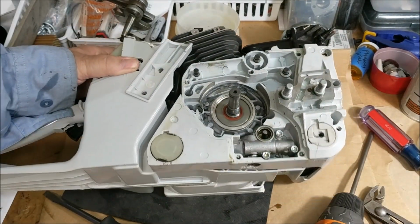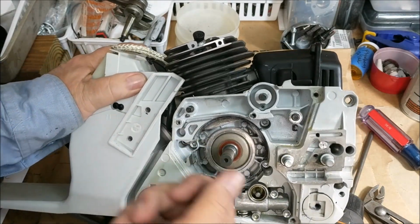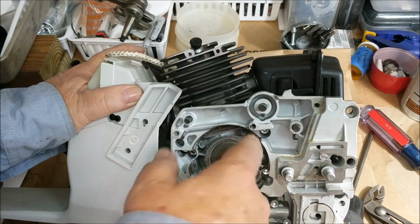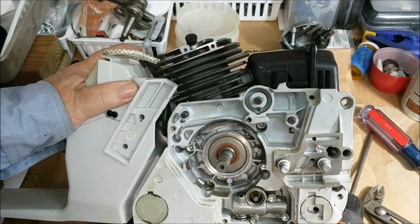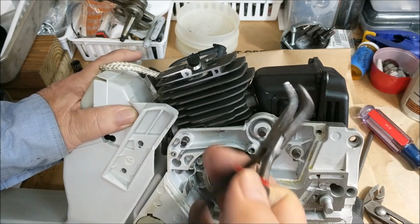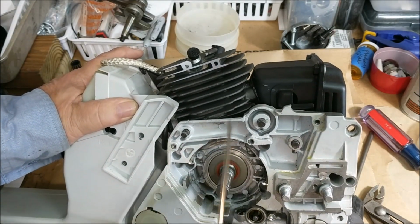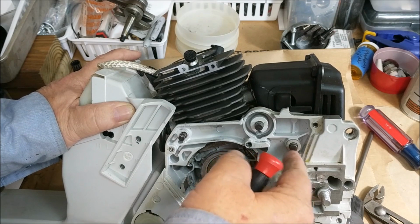On the brake, I'll just give you a rundown on it. The way I do it, obviously, I believe I pulled the band out here to relieve the pressure up here. There were two little circlips that I took these and set on top of, and then wrapped that with a screwdriver to knock them down far enough where I could put a screwdriver in there and turn it, and the circlips fell out.